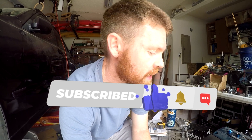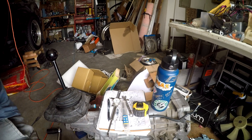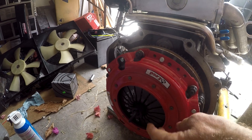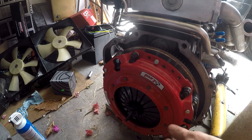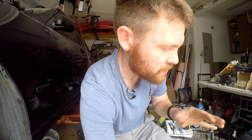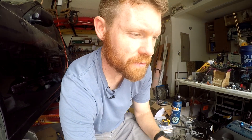What's going on guys? I'm out at the 2JZ GTE. I'm working with my exhaust manifold, trying to dial in the REV9 exhaust manifold and getting that to match up. Other little things briefly that I've been working on: I've been hammering out my transmission tunnel because the T56 is a lot larger than the W58 that was in the car. Also adjusting my Tilton slave cylinder so that when it pushes on the McLeod RXT twin disc clutch fingers, it's got a certain distance away from the fingers.